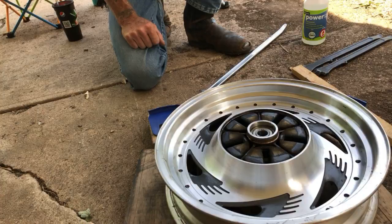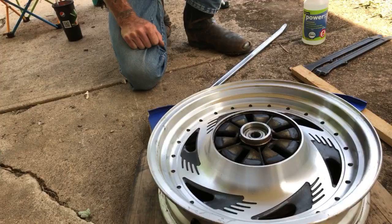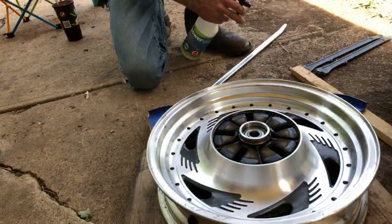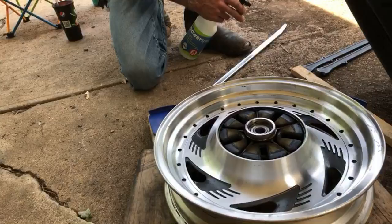Now the fun part of putting the new one on. So sprockets on this size, they're gonna go this way. Rotation goes this way. Which means grab the new tire. And it's going to go this way. And that dot there is a dot on this side. So this dot should line up with the valve stem up here. So that's there. Right there.